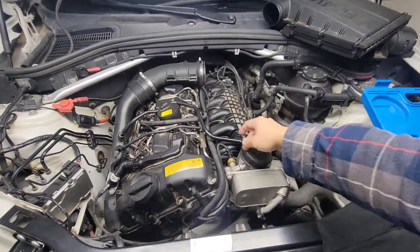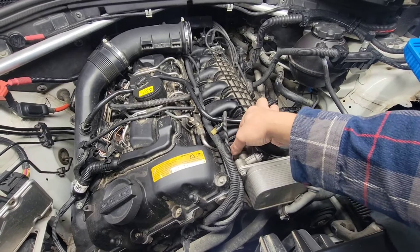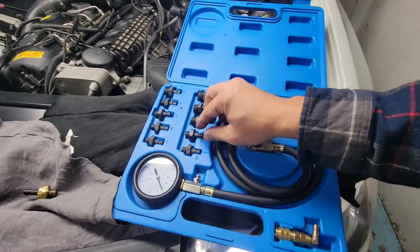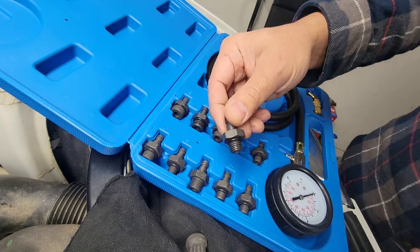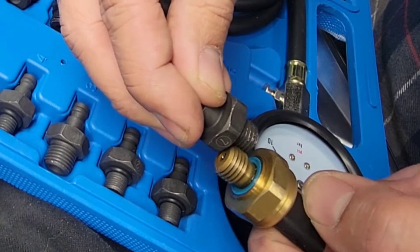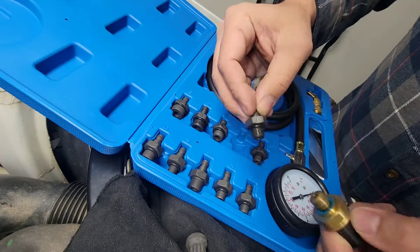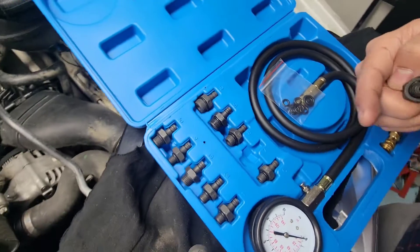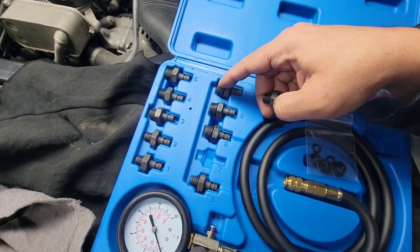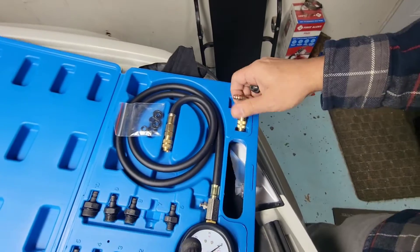Make sure to warm up the engine to the right temperature when doing this pressure test, to see what kind of pressure we get at idle. I cracked the sensor open already. The kit I'm using is number seven — not sure of the thread pitch, but if you double check and put the threads together they all go together, so this is the right one. There's a lot of different connectors here, and it comes with an extra O-ring in case you bugger one up, plus a quick connect.